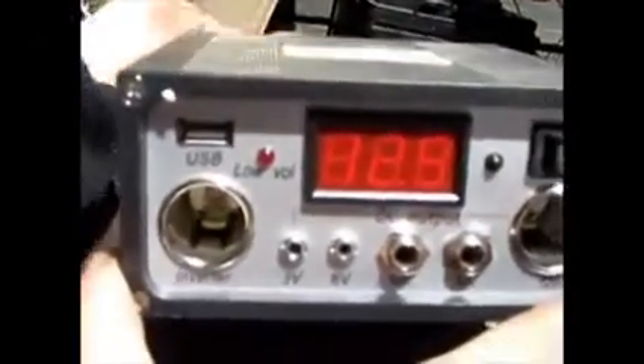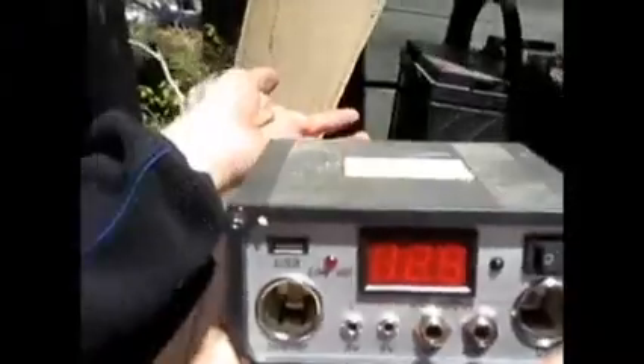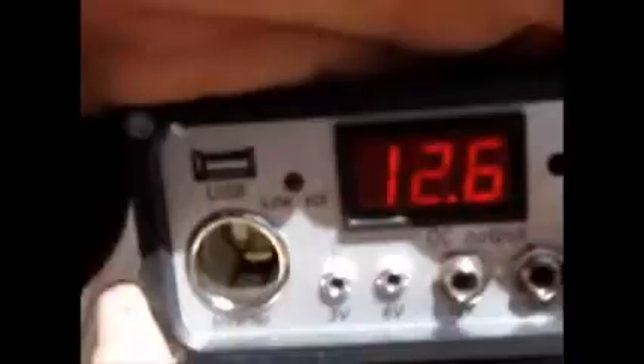It's all hooked up. Just push it on, then you gotta push the black button to get the digital readout. It says 12.4 volts — it's getting almost fully charged. Which means the battery — I think I fully charged it last October before I stored it for the winter. See, it went up already. It's full summer sun, almost summer. It went up from 12.5 to 12.6 in like five minutes or less.